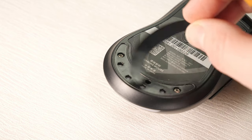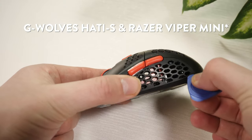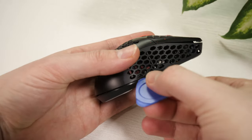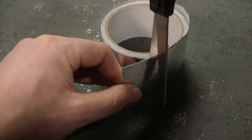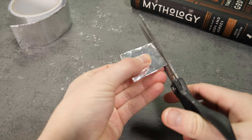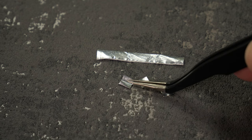If you've managed to remove the skates without damaging them, put them aside and unscrew the mouse to see what you're working with. Note that some mice have additional plastic clips holding them together, so if the mouse doesn't immediately come apart after you've removed all the screws from the base, don't tear at it like a gorilla — look online for a teardown clip to make sure you're not going to do any damage. Once you've got the mouse open, it's time to prep your tape. The aluminium tape is typically sold in 25 metre rolls. We're only going to need three to five centimetres per mouse, so prepare to pass on your six dollar roll to your grandkids because you are never running out of this stuff. Cut yourself a five millimetre strip and divide it into small squares, usually around five millimetres by five millimetres, though this might vary depending on the size of the mouse you're working on.